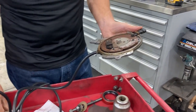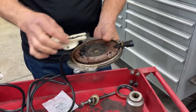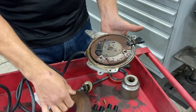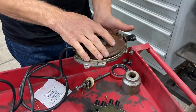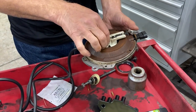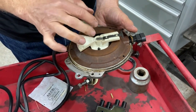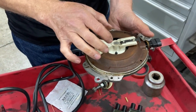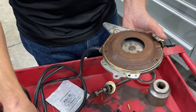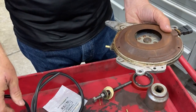While you've got this apart, there are two screws that hold your rotor on. Research says these screws can come loose. So while you've got it apart, take one screw at a time, put a little drop of Loctite on, and tighten them back up. These aren't head bolts — you don't have to torque them to 100 foot-pounds. Just make sure they're tight and you've put a little Loctite on. Belts and suspenders — I've never seen one come apart, but hey, I'm kind of new to all this anyway.